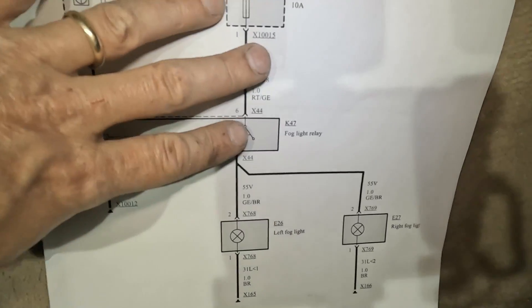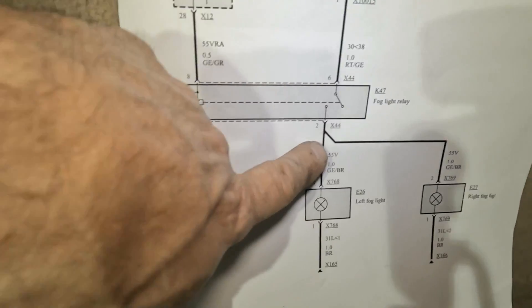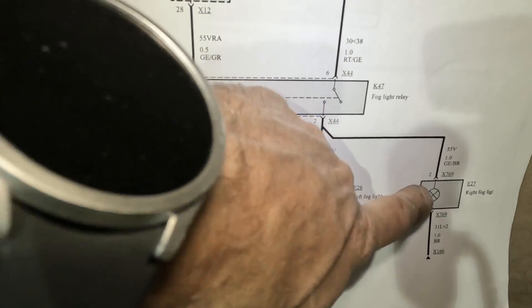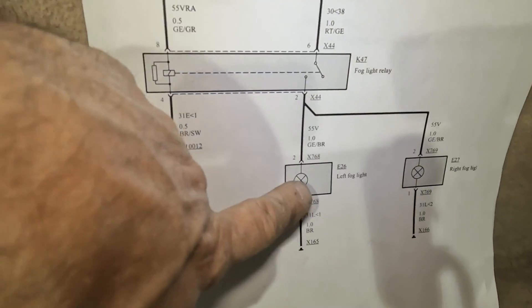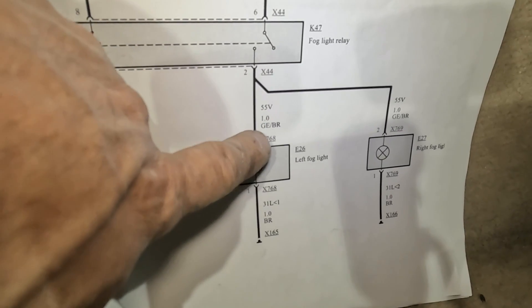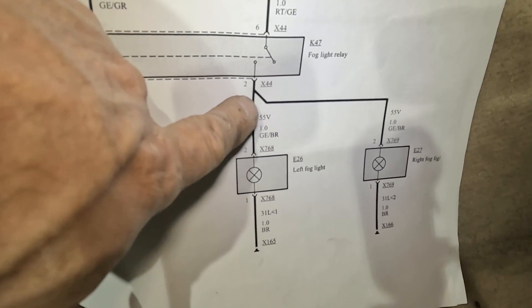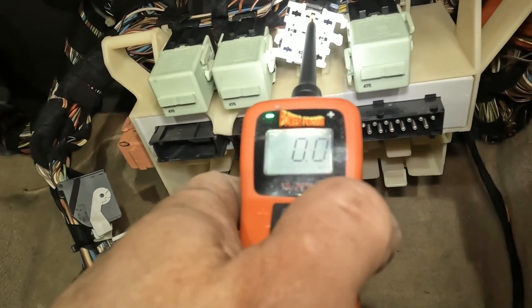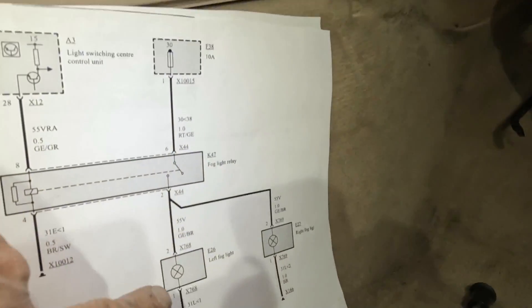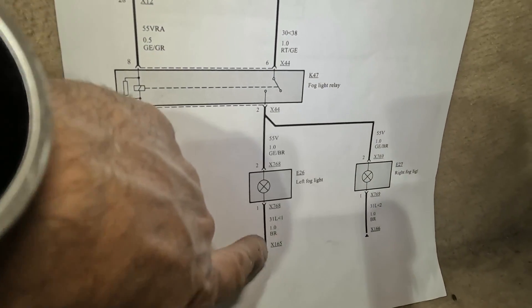I really enjoy electrical diagnosis — this is a very simple circuit. We've confirmed power at pin 6. Now if I look at pin 2 at this relay holder, it goes through my bulb and then to ground. So if I check for ground on pin 2 here — this is going to be open if the bulbs are not installed, so don't make that mistake. You have to have good bulbs installed; electricity passes through the element, which lights the element and then continues to ground. So let's check pin 2 at the relay holder. My power probe should go green and beep at me — I have good continuity to ground. That means my circuit to ground and at least one bulb — because you have two separate paths; this is a parallel circuit — at least one path to ground is good.